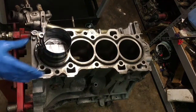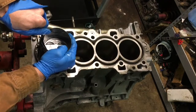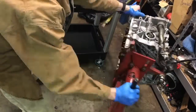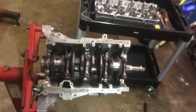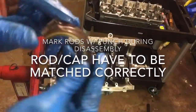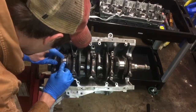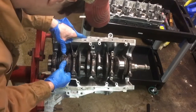Go down until you feel it stop and then snug it up as much as you can. I tapped the piston down until I got it lined up on the crankshaft. Remember your punch marks — I've got my punch marks on this side. We're going to check this with plastigauge. Get a little strip and lay it as straight as possible — don't put any lube on it.